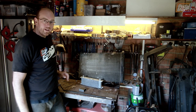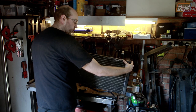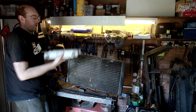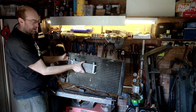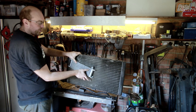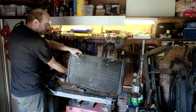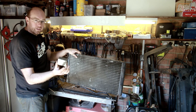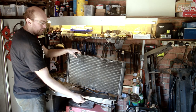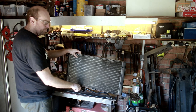I've put the radiator back into the radiator bracket — I spent some time last night cleaning it up, and now we can start looking at where the oil cooler is actually going to mount. The plan is to have it held approximately here across the radiator. Off to this side will be above the gearbox, so it should have good free-flow through, since the engine sits more on this side. I'm going to make a bracket that welds onto this side using some 30 by 60 steel, and then have a bolt-on, bolt-off bracket that supports the rest of the oil cooler.